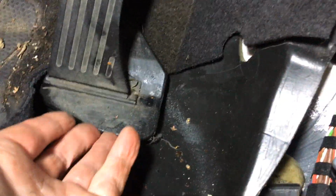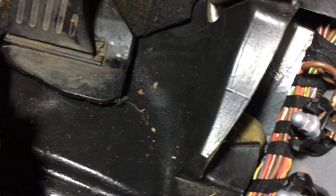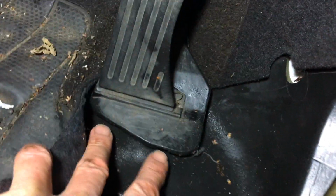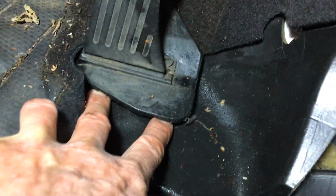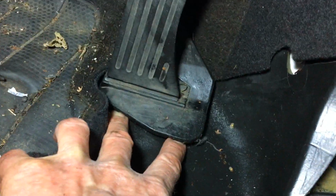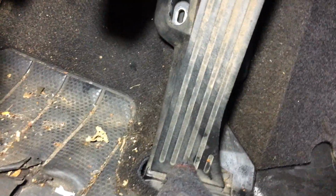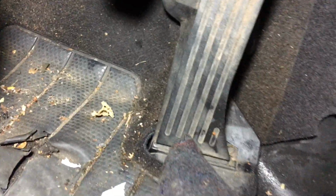It'll slip out underneath this accelerator pedal. I just don't feel confident trying to bust that out of there without the special tool, which has two prongs, apparently goes underneath and releases the pedal from two studs. So I guess there's some sort of circlip. So we've removed the stabilizing bolt at the back there, and I'm going to get the whole carpet out from under that pedal, and we'll fix it back together the best we can once it's dried out.